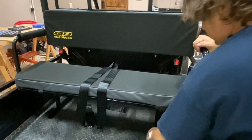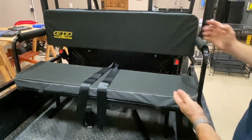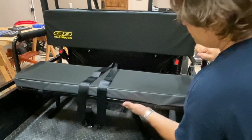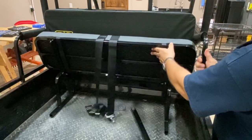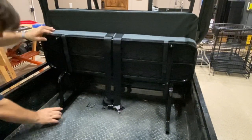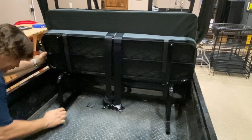I'm trying to get the alignment for the tracks in the bottom to figure out where to drill — there are two holes, front and back, where the track pins will go in. But it's just too tight with the armrests, so I'm going to lose the armrests and just be done with it, because trying to lift the seat up is a really tight squeeze and those pins just aren't going to work. Based on the length of the pieces as they come, I'm going to have to come about an inch off the back wall for the holes to line up.